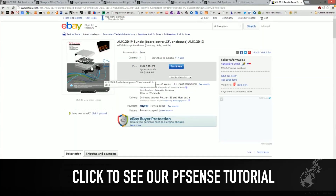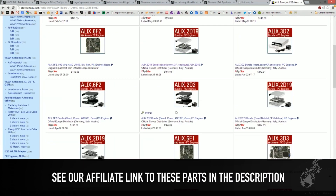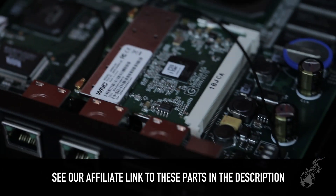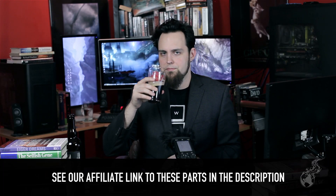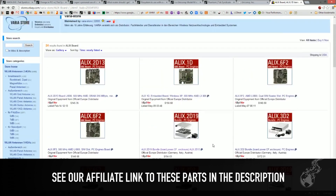Here's a great little bundle — it's $200, and you get the board, the tiny enclosure, plus a compact flash card for your OS. It's so simple to install — just watch our PFSense video, install it to the compact flash card, plug it in, and it's running. If you want wireless, get a separate wireless box and plug it into one of the network ports. I'd recommend a Cisco dual-band — they're like $200 on eBay right now. Some of them you can even install a wireless card on board. You can get wireless AC, though PFSense has kind of spotty wireless support at the moment. You can also run DDWRT instead of PFSense on the same hardware and get a little more mileage out of the wireless, but I prefer having a separate device for wireless.